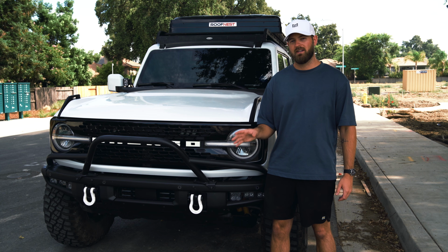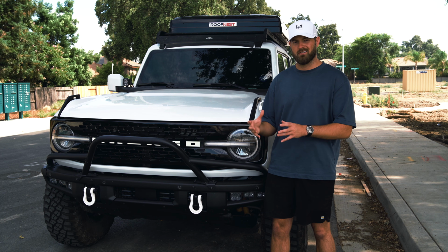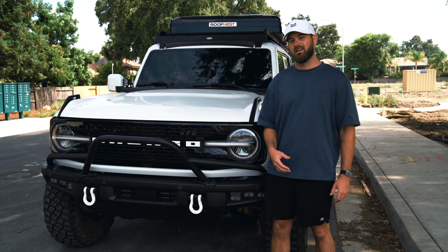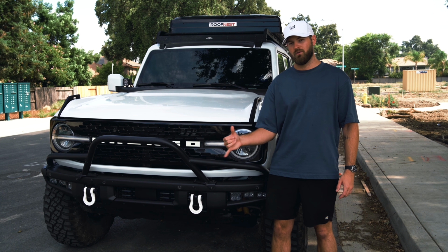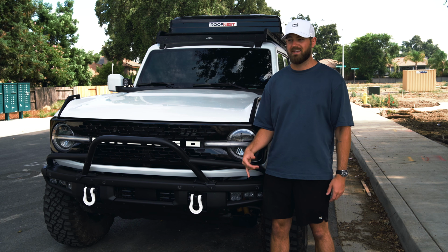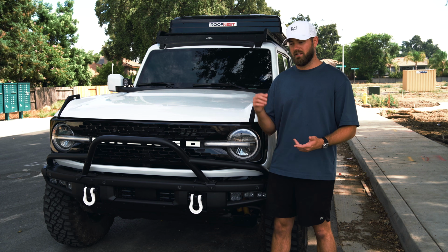The only thing I've had issues with has been the Apple CarPlay, which is the big 12-inch screen or whatever. It sometimes logs and doesn't really want to let you go to the next page, or it doesn't want to connect. To fix it, all you do is hold the power button and then the next button, so like the little arrows to the right, hold those together. I'd kind of do one of these, kind of like a shaka. Do that for about 5 seconds. It'll restart the system, and from there it fixes it. So I can do that while driving. You don't have to go ahead and restart the vehicle like other people have said. Beyond that, the 4x4 system has been excellent.